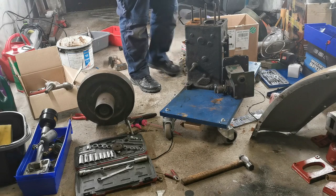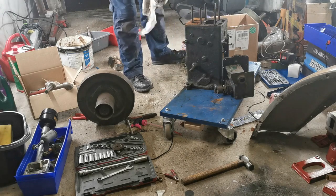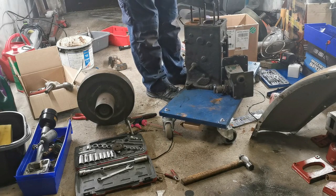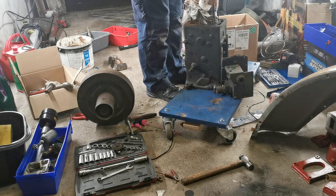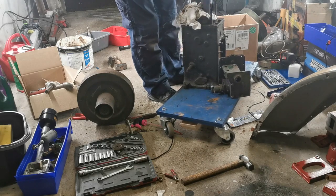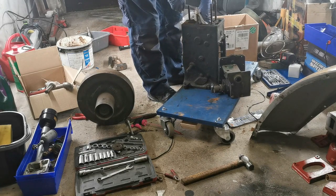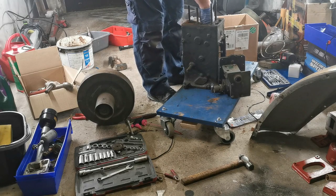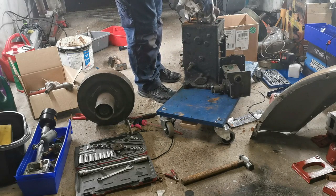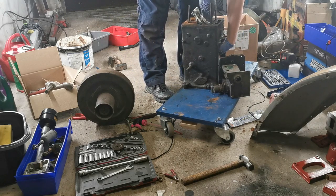It's a steel piston. So, more stuff for cleaning. Those in there. Let's give the bore a wipe and see how that's looking. And we'll give it a run with the honing tool and see how we're looking after that. There's no point in running the honing tool after you've cleaned it, because you're going to make a mess anyway, or at least something resembling a mess. It's better off to kind of do all the dirty work and then clean it up afterwards.